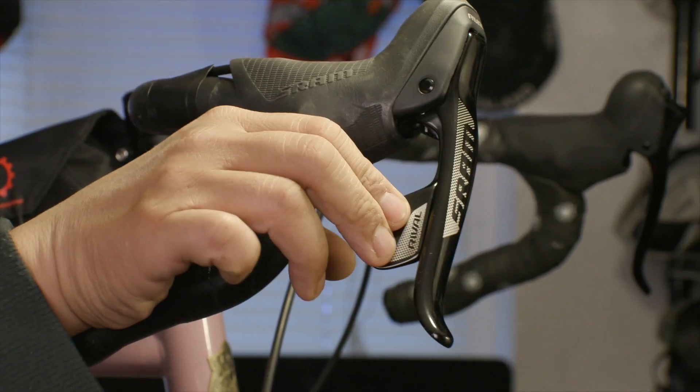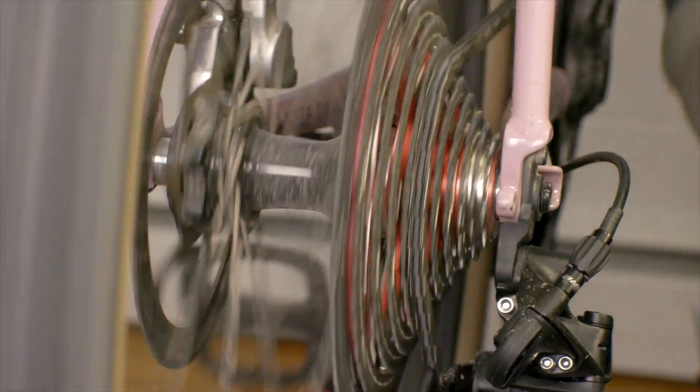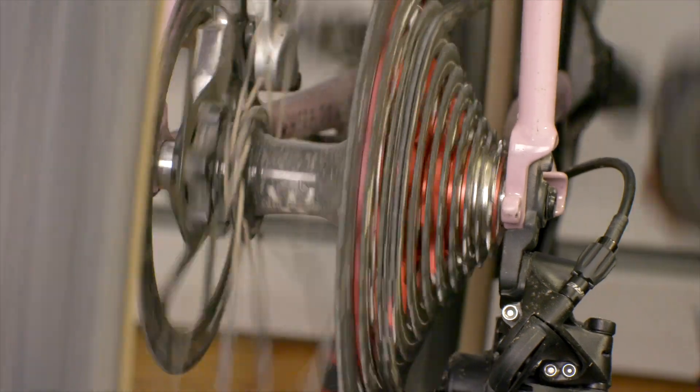Even of those 10 gears, it was a little bit bodgy. For those of you that are able to shift an NX Eagle rear derailleur with a Rival shifter, I don't know what's going on — I've not been able to replicate it. I've actually used two different NX Eagle rear derailleurs and still no luck. So either you're super lucky or you're not actually using these parts that you say you're using. Myth busted: Rival brifter does not shift an NX Eagle rear derailleur, at least on any 11-speed cassette I've tested it with.